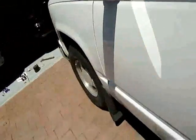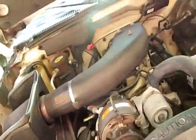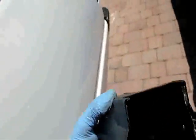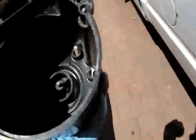Smooth, man. Way smoother. It was jumping last time I cranked it. That's good - real good. Wow, that is smooth. See what happens with these caps - the humidity, all that moisture in there just starts eating up those posts and you're not getting a good contact when the rotor comes around and it's charging the coil. That thing runs like new! No shake. I'm very happy. That's how you do it - you save yourself a shitload of money.